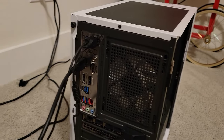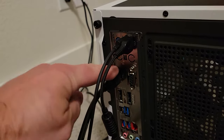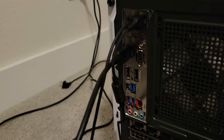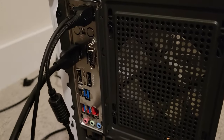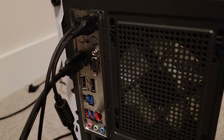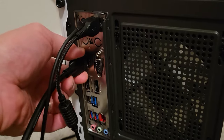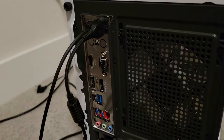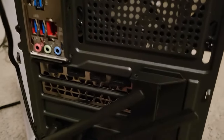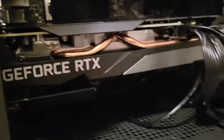So here's the back of the computer. I had plugged the monitor into the HDMI port on the back here — right here. I plugged it into that and routed it up to the monitor. It seemed like that was the logical thing to do. Well, guess what? It's not the right thing to do. You do not put your HDMI cable there — that goes into the motherboard. Where you need to put it is into the graphics card.